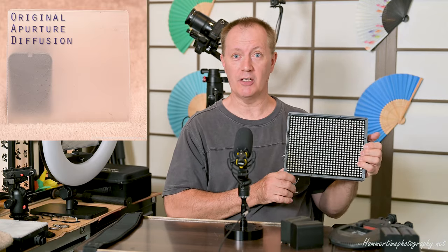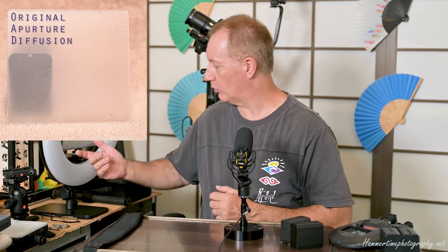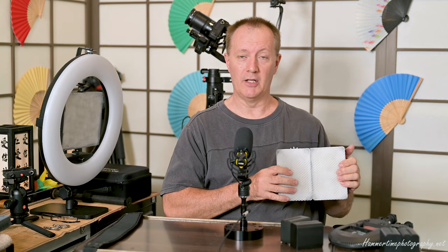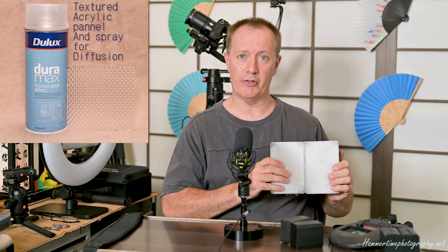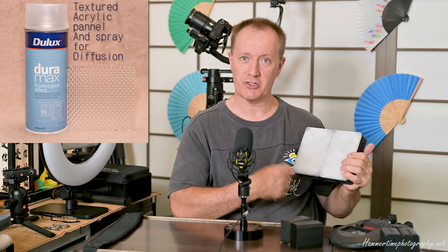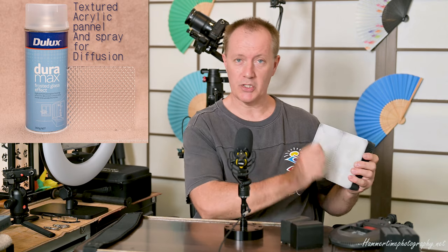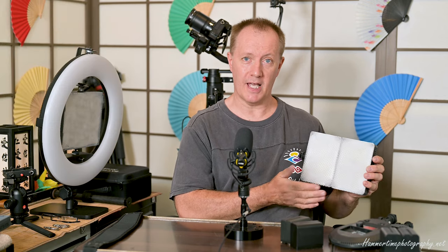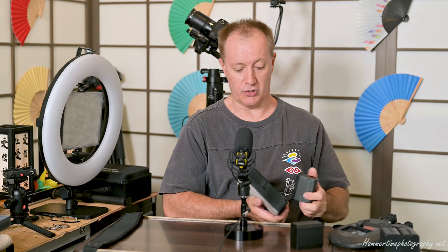What I do is I've actually ripped them out — as you can see, there's no diffusion panel, just the LED bulbs exposed. To fix this potential issue, I devise something for myself. I use that corrugated crinkly plastic cover you see on ceiling fluoro lights. I've got that perspex cover, and I've also sprayed a frosting over it — like Christmas frosting spray used on windows to decorate seasonally. So a diffusion spray over the top of that already crinkled perspex, put on instead of the traditional clear plastic they provide — it's an awesome diffusion.